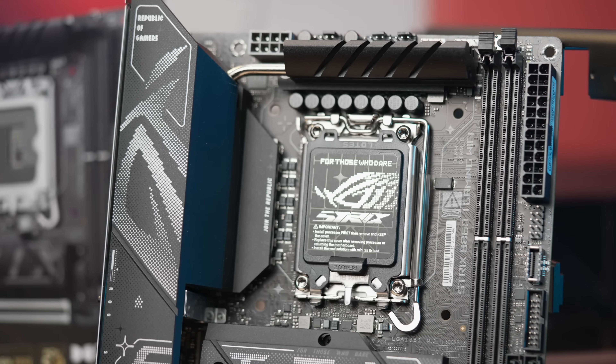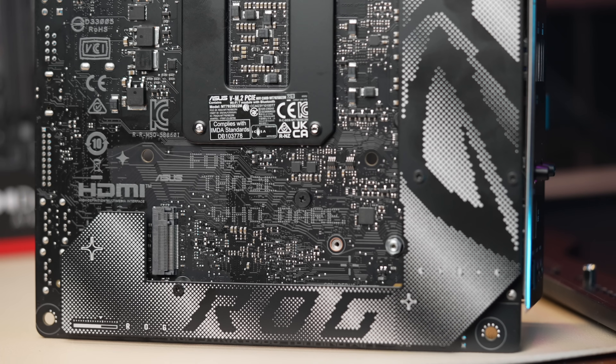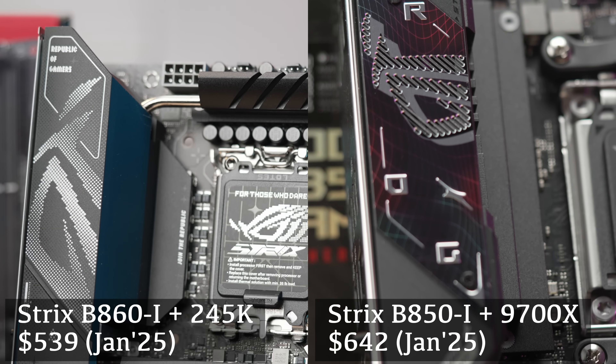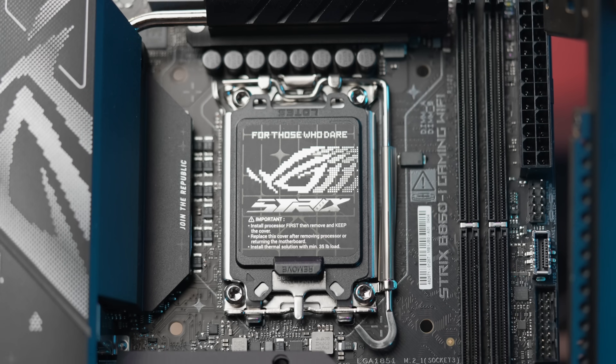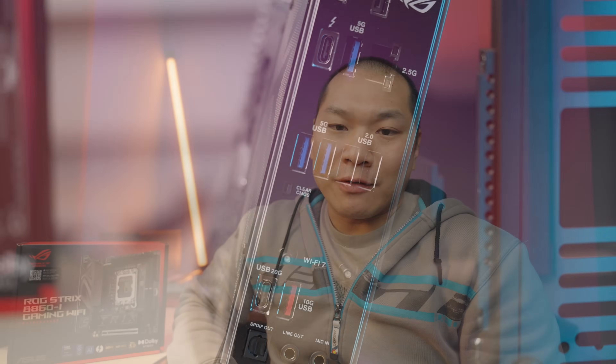This board actually has quite a few features I would have liked in the B850i, in addition to the lower price: passive board cooling with no mini fans, a full metal rear IO heatsink, more SATA ports great for a workstation build, and a partial back shield — better than nothing. Other than the inability to CPU overclock on B860 versus AMD's B850 — which is an Intel platform thing, not a board manufacturer limitation — strictly for a mid-range build this demands serious consideration. The total platform cost is significantly less than the AMD equivalent, and while there are cheaper B850i boards, for equivalent features and build quality this Strix is the right comparison. We'll revisit this in a build when the non-K chips arrive.